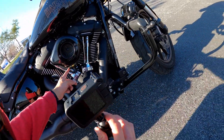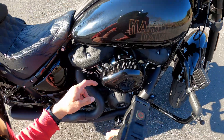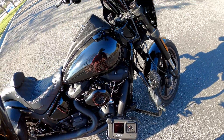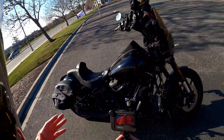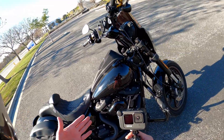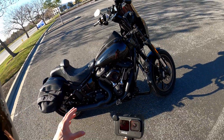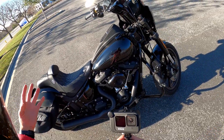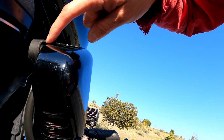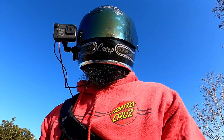I have an external air breather for the exhaust air ports, and I'm using the stock air breather bolts from Harley-Davidson on the 114. I have a whole video on how to install this without destroying your air breather. You don't have to drill into the backing plate or clog those little ports that shoot into your throttle body. If you've seen Blockhead's video — they drilled into it — but you don't have to do that. The oil comes straight out through the bolt and goes into my catch can.